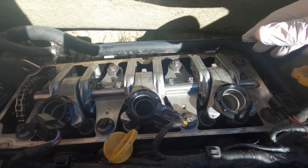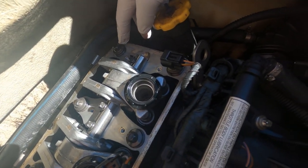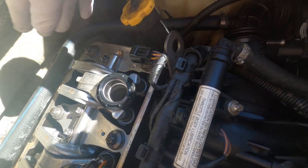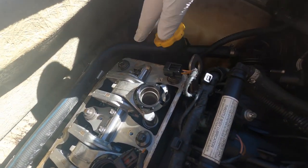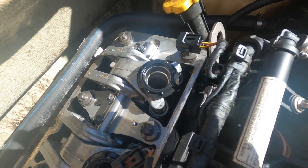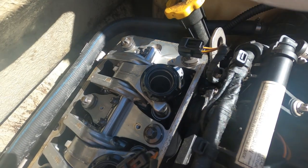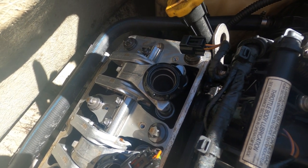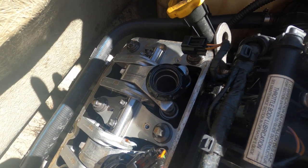We now have all three new pipes in with oil on them. Next we need to put the cover back on. We have a new seal — the old one doesn't look bad but we'll change it anyway. As you can see, we need to scrape off all the old rubber from the old gasket. Make sure when doing that you cover the surrounding area so no dirt gets inside. Scrape toward the outside, not the inside. Then we'll install the new seal on the cover and apply oil around it.